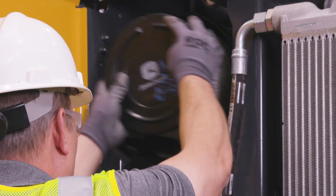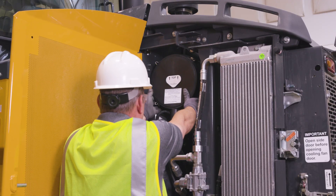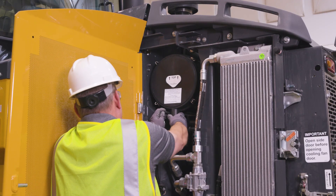If the filter gasket is damaged in any way, replace the element. Be sure to reseat all filter seals securely when reassembling the air cleaner, no matter what type of filter you have.